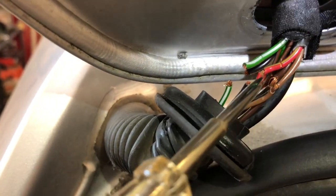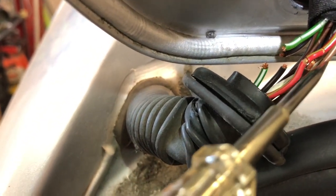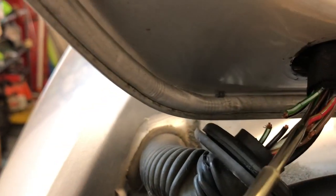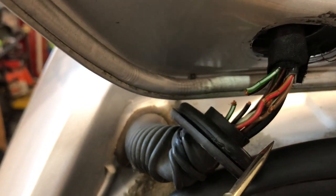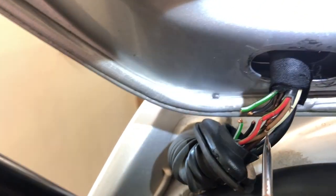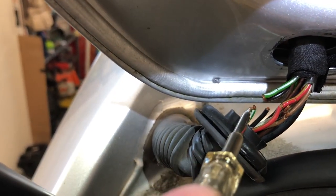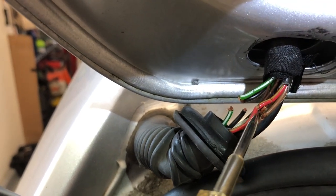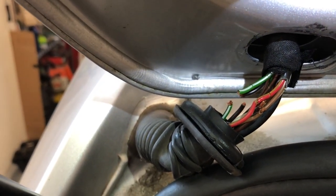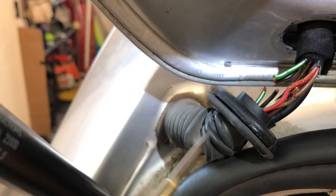The other ones you can see - the material that made the wiring sheath is brittle. Not on all of them. The big black one isn't, but the red and green and the brown one and a few others are showing some sign. There's a weird striping on this white one back here too, where it's just splitting. The ones that have snapped, I think I'm gonna add a wiring connector in there and crimp it. The other ones I'm just gonna use electrical tape and wrap it up. It's weird that it overextended these and straight up snapped the wires, so there's obviously been some pressure on there.